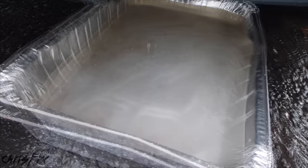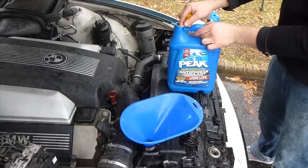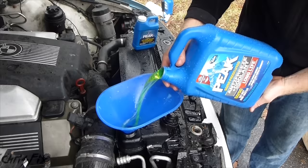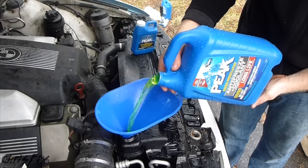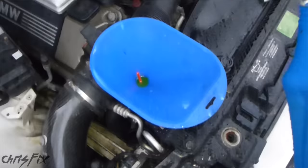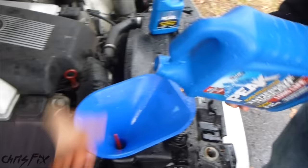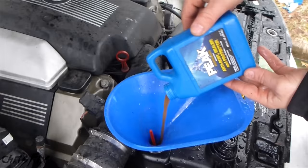Now we're going to add the brand new 50-50 antifreeze mix. Before we do that, let's install the drain plug — make sure you lock it into place so you don't have any leaks. The antifreeze we're using is compatible with all cooling systems, but check your owner's manual for the correct type. We know we need three one-gallon containers to fill the system; if we don't use all the containers, we know some water is still stuck in the system. A little water is okay, but you don't want too much or your water-to-antifreeze ratio won't be close enough to 50-50. When you can't add any more antifreeze, start the engine and it'll suck it right down — just keep adding it. Make sure your heat is on. A little trick: if you turn the bottle sideways when you pour, it'll pour out smoothly and won't splash. Now we're adding our anti-rust and sealer additive — this engine is old and the additive will prevent any leaks due to the flushing of the cooling system.